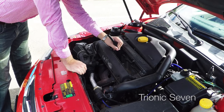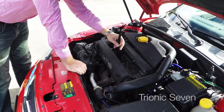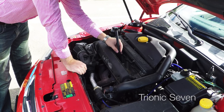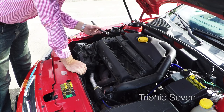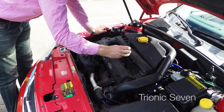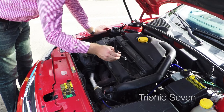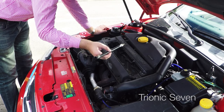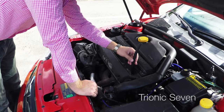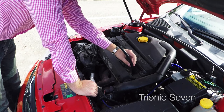I can't put the image in the video due to copyright, but I recommend you go Google for a spark plug chart. There are a number of images on the web and you can see for yourself what your spark plugs look like and compare. You might find things like coolant leaks or oil burning just by looking at the spark plugs. You could also use a special spark plug tool, but I found the fuel hose works fine — this way you won't drop your plugs and you won't damage them. It can also be a good idea to use a vacuum cleaner to vacuum up here before you remove the plugs so you don't get dirt down into the cylinders.